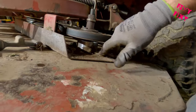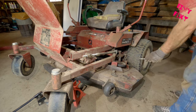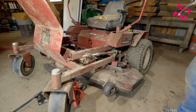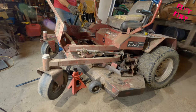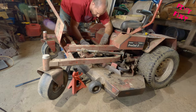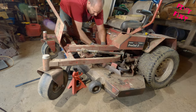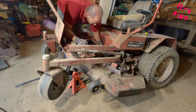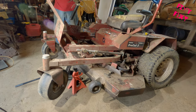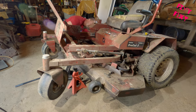Since you're going through the effort to pull these shrouds and you've got easy access to it, start greasing the stuff that's underneath that deck — spindles at bare minimum. Those puppies spin fast and they spin pretty much the whole time the mower's running, so they're getting some wear. You put a little grease in them, you're going to get a little more time out of them and they run much better. If you've got to replace one of them, you're going to wish you had greased it more often because getting those pulleys lined up is a bit of a nuisance. So save yourself the effort — just grease it.